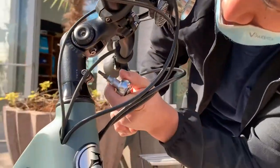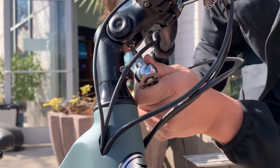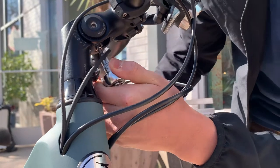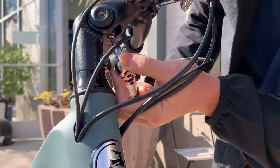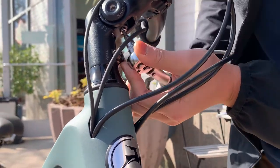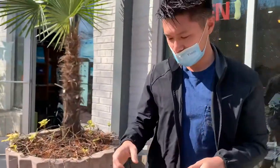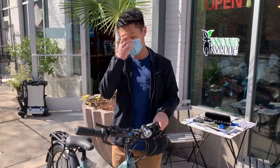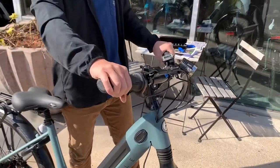All right, now it's up there. We'll tighten this all the way down. I just want to hold the steering here so it doesn't turn as you turn it. You hear that click — we're good to go. And that's it. That's how you adjust your stem angle bolt or your stem angle. You'll notice the angle of your handlebars may not be in the right place, so you'll have to adjust those — we can show you that in the next video. Thanks for watching.